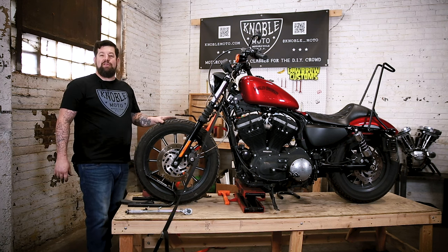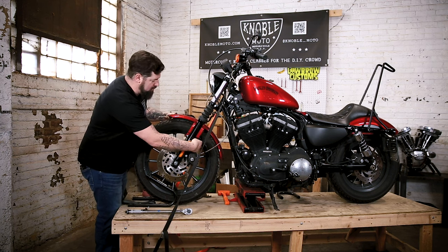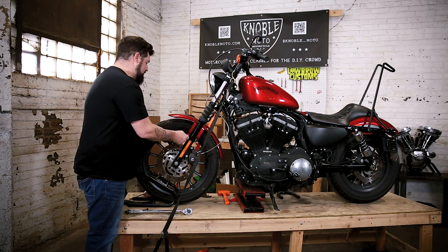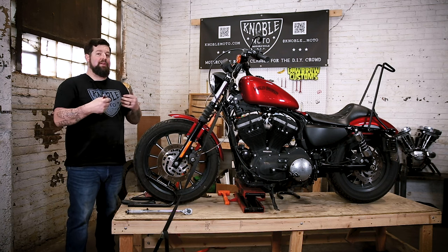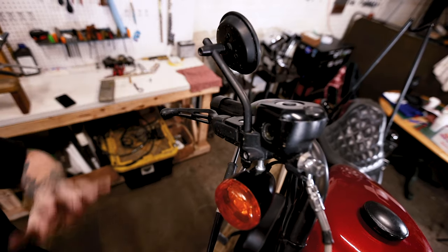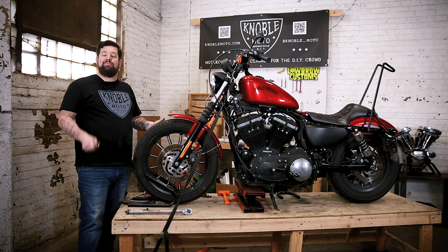From there, reinstall the front fender. Your fender bolts are back on, everything's back on and tightened up. Now, last thing you want to do is pump your brakes a few times, because since you had your caliper off things have moved back a little bit — pump it up to make sure you still have front brakes. That's all we have. Lowbrowcustoms.com has all your brakes, parts, and accessories for your Sportster covered. This has been a Noble Tech Tip — we'll see you next time.